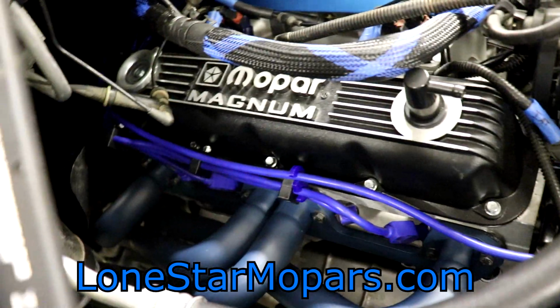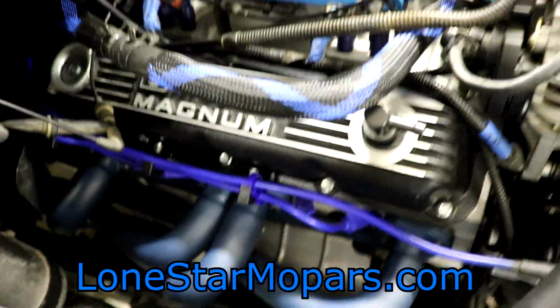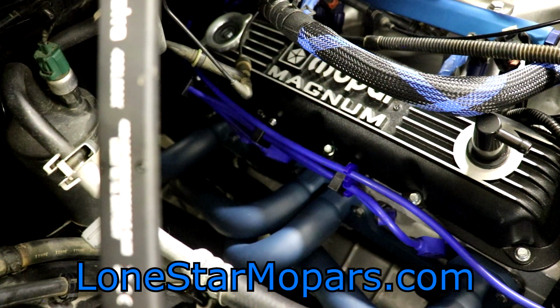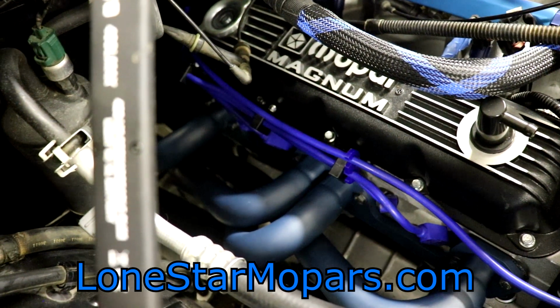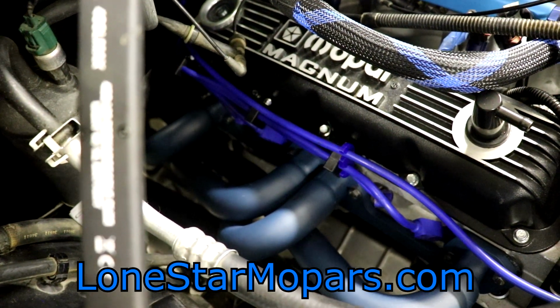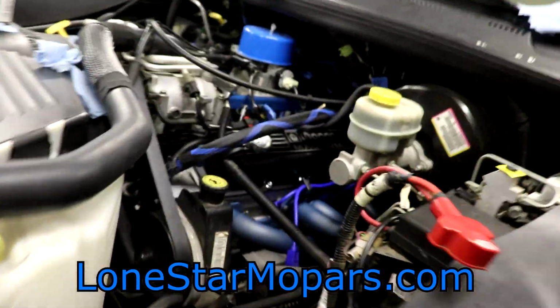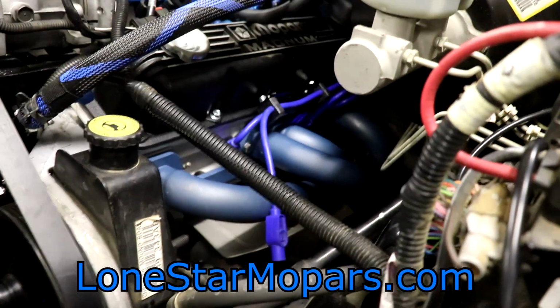But yeah, here they are. That is our blue titanium long tube headers, finally pretty much installed. Again, just have to torque it, which there's basically 2 bolts per side that is stupid hard to torque. Obviously you'd like to torque things square. It's sort of hard to do that with the header setup here. Here it is on this side. I need to put that spark plug back on.